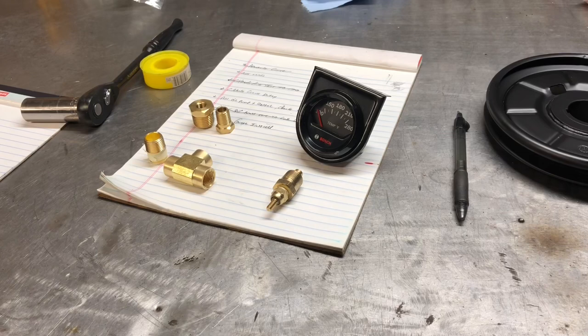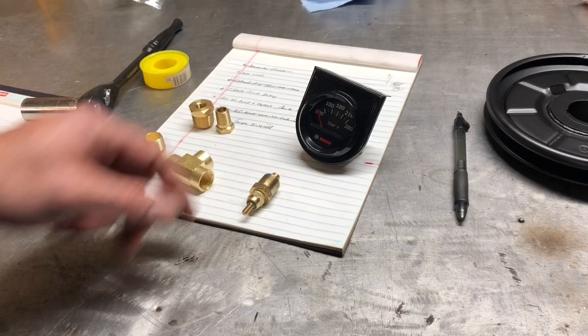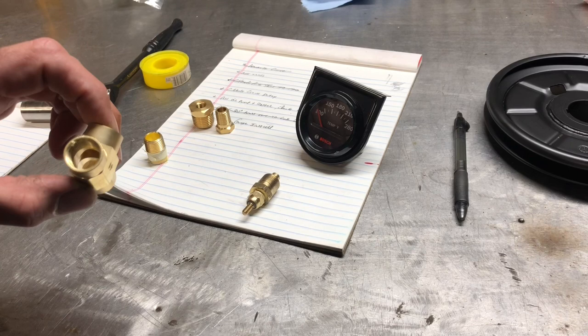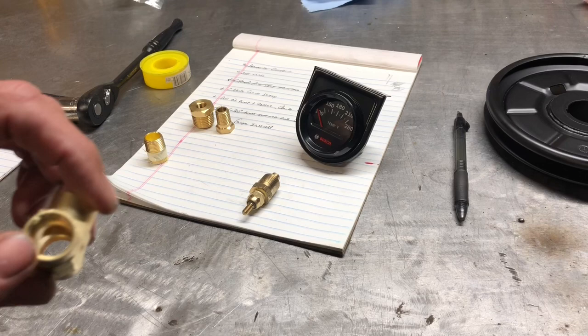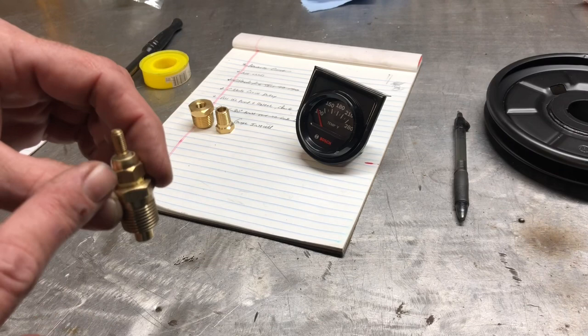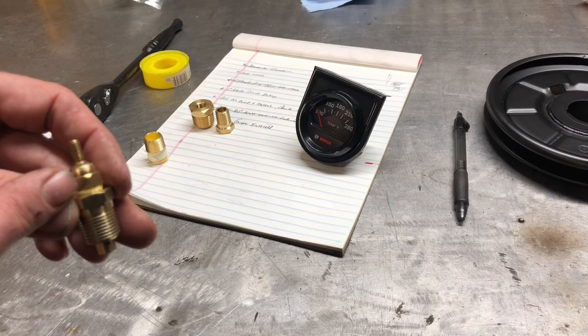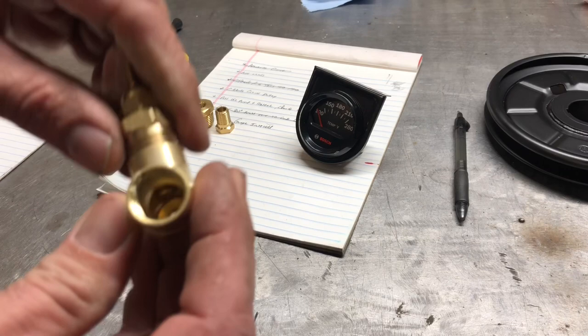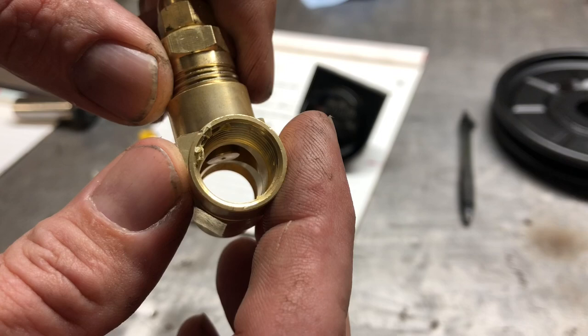All right, YouTubians, here is the oil temp kit that we'll be using. It is an electric kit, which means it's running an electronic sender — not an actual cable back and forth, just a wire for the sender. On my oil flow setup, I'm running 3/8 NPT fittings to half-inch barb, which gives me as little restriction as possible, giving me a nice full flow. With the sensor, it comes 1/8 inch, and in the kit you get a couple different size adapters up to 3/8. The sensor actually sticks down below, and if I thread it in — hand tight — it's right there at the top and not restricting the flow, so it will still measure oil temperature without hindering flow. That is the most important thing.